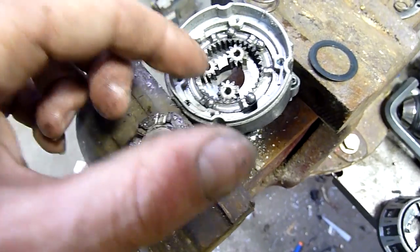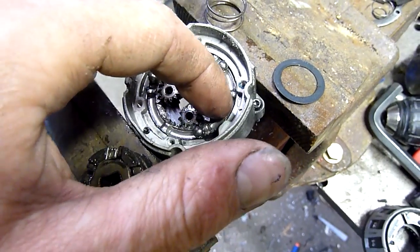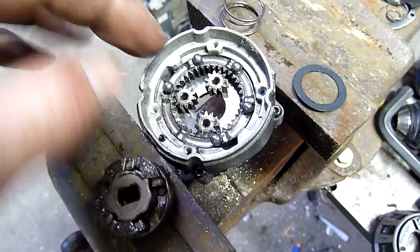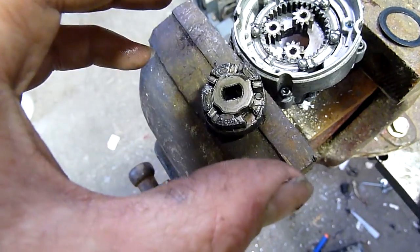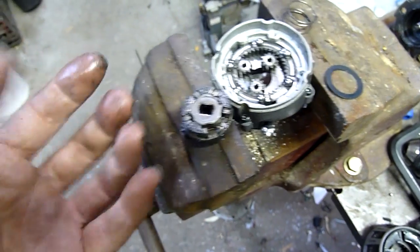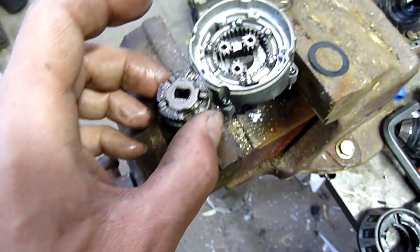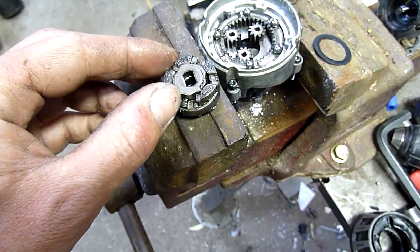When they slip over, the whole lot is going to pop out and just slip. They're all pushed against their little lands in either direction. When it slips, they all hop over to the next one — all of these expand, releasing that drive dog which is connected directly to the main shaft with the chuck attached to it, and it slips. That's all I can figure. So it's not like an old one — I pulled one apart years ago and it had these little pressure plates or fingers in it. This is completely different. Not what I was expecting.